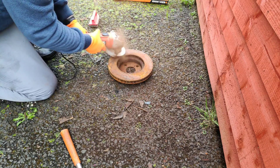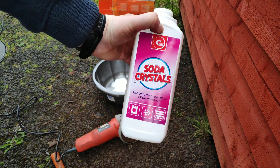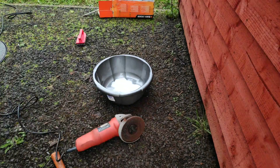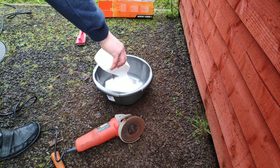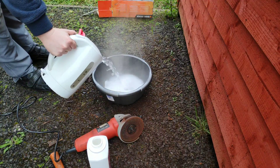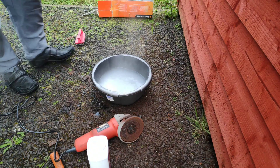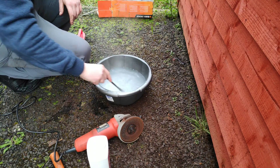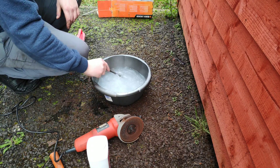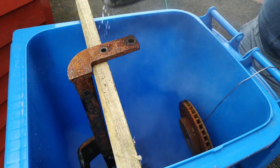So we're going to use this as our sacrificial piece of steel. The first thing we're going to do is make up a solution using soda crystals, which you can buy in the laundry department of a lot of places — the main ingredient is sodium carbonate. This particular one can be bought pretty cheaply; I think I got this for around 70p in my local general goods shop. We can add some boiling water to try and dissolve it fully into the solution. You probably don't have to use as much as I used — I've gone a little bit overkill. They say there are certain ratios to be met, but because I'm doing this in a wheelie bin it was going to take too much time to figure out the exact amounts, so I just added in about half the pack and that did the job.